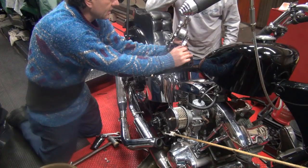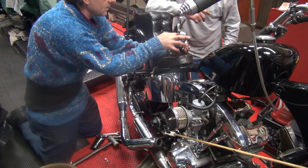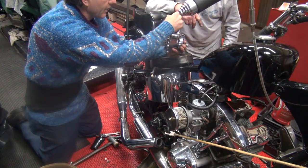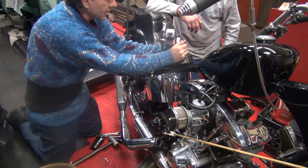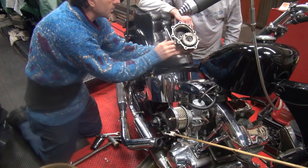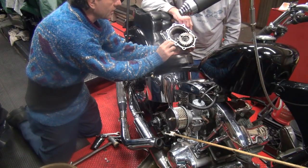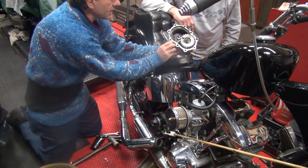Want to set the throw-out ring in that other cover just to see? Well, it didn't work that well either. It didn't work in any of these covers. Oh. That's the problem. Even the one I ground out? The one I came in with? Yeah, it didn't move very far. You're right. One thing I do see here is a whole bunch of rub marks, but I think those are from the grinder where it didn't clean all the way across. That'd be my guess.